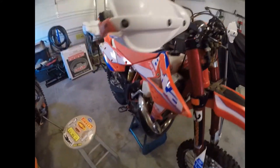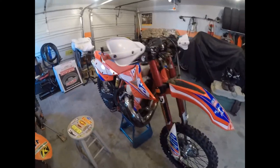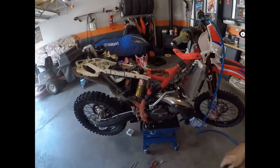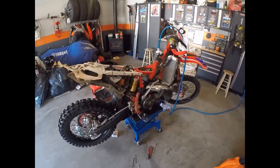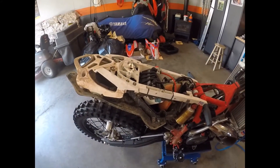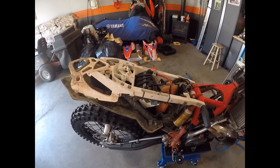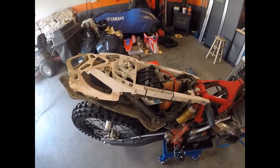So that's it for now, more to come — looking forward to it. Good morning, welcome back to Gnarly Chicken. So I picked up the '17 and found there were some voltage issues with the battery. It's giving a charge around 12.2 volts, but it should be up around 14 volts when it's running.